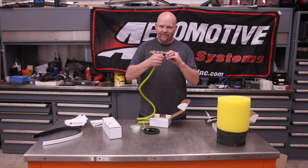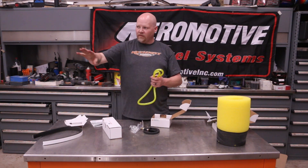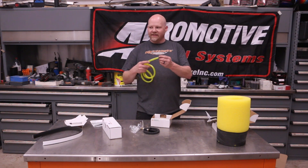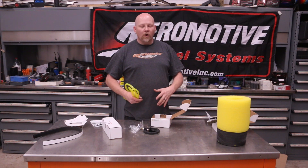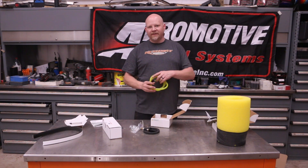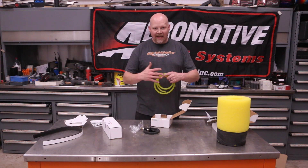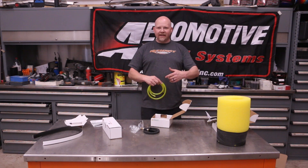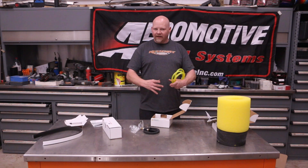This is magnetic, so you put it inside your tank on the cool side. The original phantom is mounted on the driver's side, so I would put this in the rear on the passenger side. This ensures your fuel pump always has access to fresh, cool fuel. A lot of people don't realize with EFI systems that fuel pumps need to be cool - an external fuel pump doesn't have fuel all around it keeping it cool, so anytime your return system dumps close to your fuel pickup, you're heating up the fuel in that area.